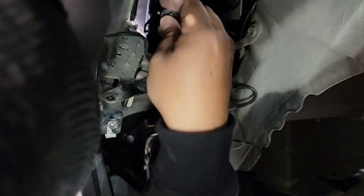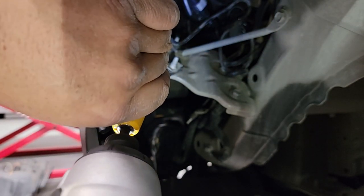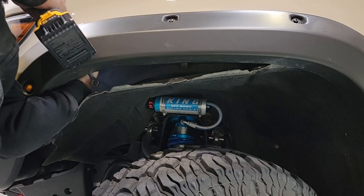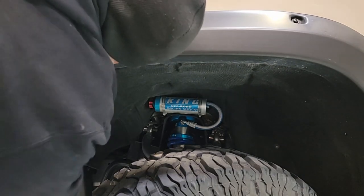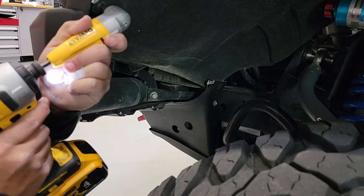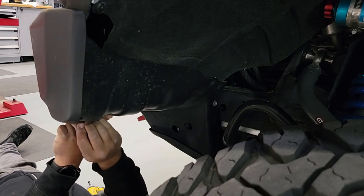Starting at the very top, put the 7mm screw back in, then the middle, and then the bottom. When tightening these up, pay attention to the seam line on the outside — the fender and the filler panel should be fairly level and flat between the two. After that, resume putting back all of the fender flare bolts. These will be different for the Highmarks — they're bolts — while on the standard Bison ZR2 they're going to be snaps. The goal is just to get the fender back in place, then tuck the inner fender liner in for the Highmark or screw back through the inner fender well on the standard ZR2 Bison. The two front screws are unique to the Bison and hold in the inner fender liner. There's also a replacement half-spat that you can take off without removing the whole skid plate — a nice feature when adding the Highmark for extra clearance — secured by three final screws.